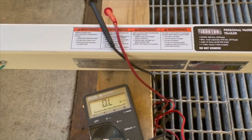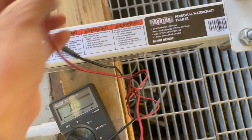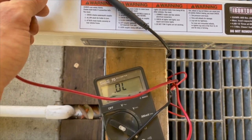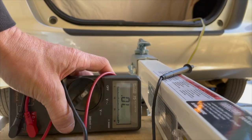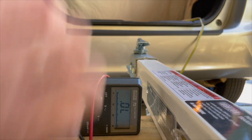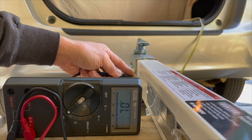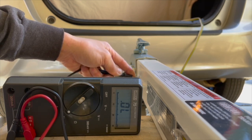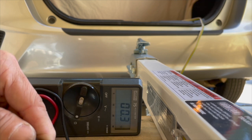It's separate pieces. And to back it up, I tried my ohm meter here, the resistance, or I could even do continuity testing right here. If I do continuity testing, you can hear the beep. Right? So let's see if we can hit a beep here. Actually, I'm gonna set this up without dropping the phone again. Actually, let me set it up from this side. Right there. Let's do that continuity test. So again, touch. Right, you hear a beep and you see the numbers. So I'm touching the back, so now I'm touching both sides, both screws, nothing. Use the ohm. It should pretty much be pretty low resistance. Right.